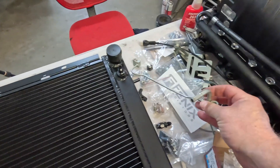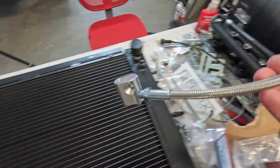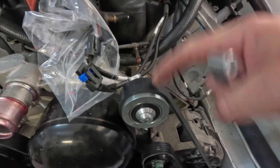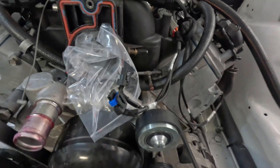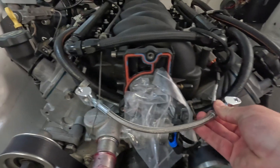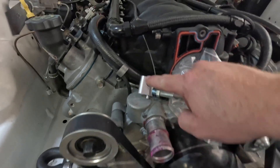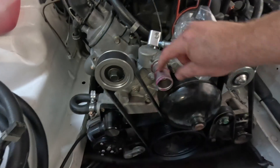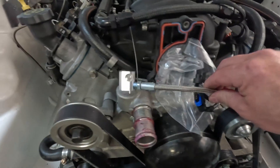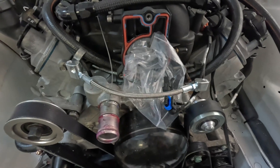The idea is that's the steam port that Harrop supplied to get it out of the road. But I was going to run one of these aftermarket adapters. The pulley gets in the road, which is why Harrop supplied one that sits up a bit higher and off to the side. But this one actually relocates the steam port to the driver's side of the engine, then follows this coolant pipe around. Hopefully it looks a bit neater - that'll be the AN fitting to the radiator.